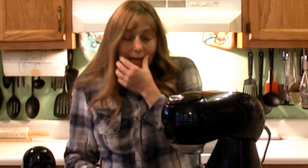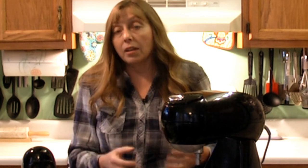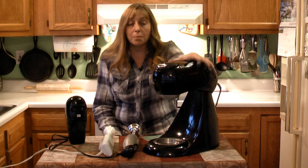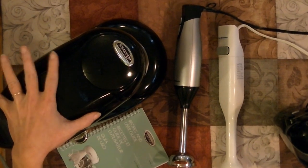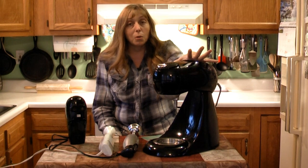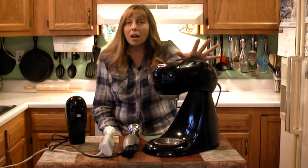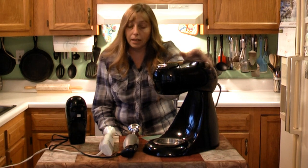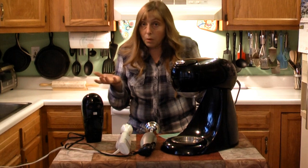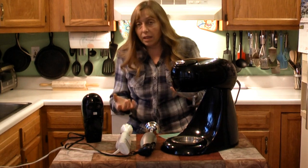What duty cycle is, is how long an electric motor can run before it gets so hot that you should shut it down and let it cool off in order to avoid damaging it. Now if you run your mixer until you start to smell it, you are doing damage. If you run it until you see smoke, you are doing severe damage, and if you have a lot of smoke it very well could never run again. That's because so much heat has built up in the motor that it's burned the winding — it burns the oil out of the gears and the motor will seize up.